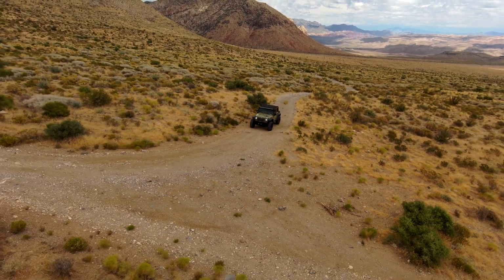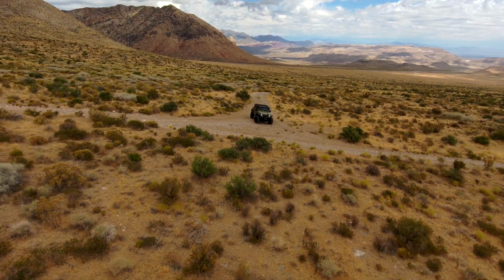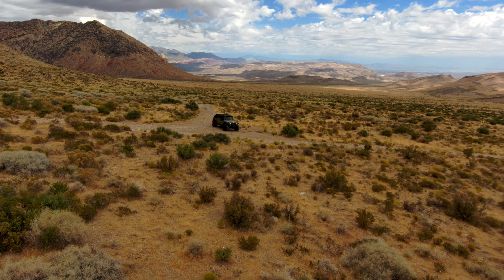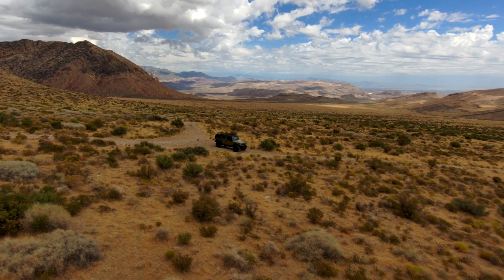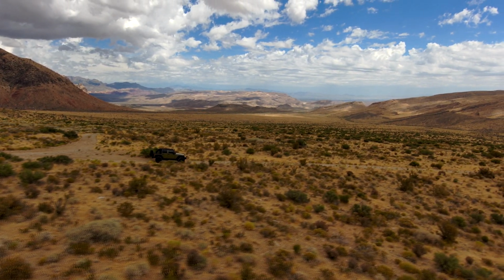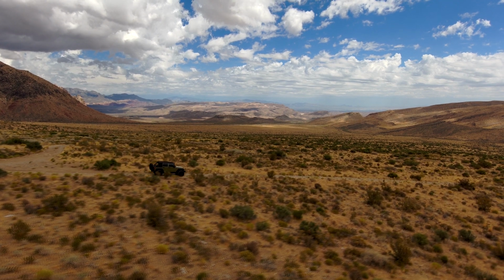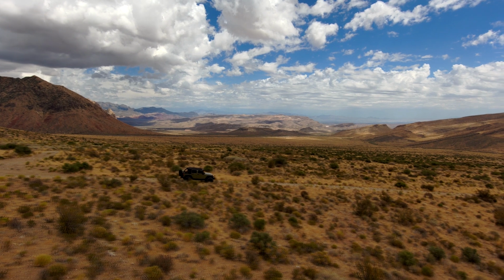The air's got to go in and out. The engine compartment is under a higher pressure than the atmosphere outside, so it's difficult to pull that air in. So just use common sense. You got to get air through that engine compartment. I have a thermal probe for one of my MasterTech lab scopes, and you can't believe how hot the underhood temps can get in these vehicles. I've seen them approach 300 degrees, like I said.